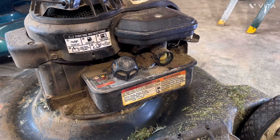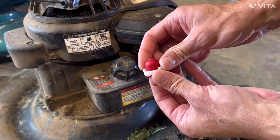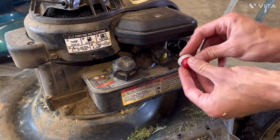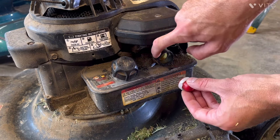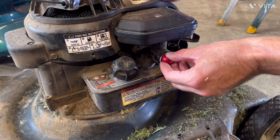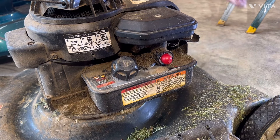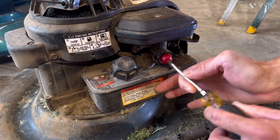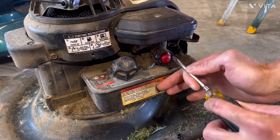Once that's cleaned, you should get a nice seal on your new bulb. Take your new priming bulb, put it inside of the clip — the metal or plastic ring — so it looks like that. Then go ahead and push it in. Make sure your tabs are lined up with your two holes on either side. That makes your life easier so you don't have to try to twist it inside of there. Once you've got it into position, kind of push it in evenly on both sides.